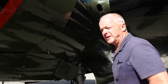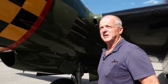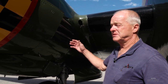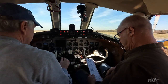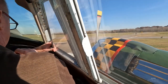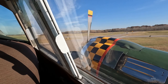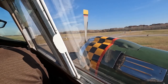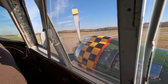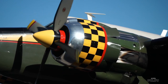It's a little different starting one of these. You're starting it with the mixture at cutoff, and you're actually starting it using the priming system, which unlike most engines, it doesn't prime in the cylinders. The carburetor on this is a big four-barrel Holley sitting on top, and you're actually priming — squirting gas in the carburetor inlet. It's a pressure carburetor. That goes right into the inlet of the supercharger and then onto all cylinders, so when you are priming it, you're priming all cylinders. Then when it's happy, you're holding the prime on and squirting that gas in there, then you bring the mixture up to a rich position, and it'll start gagging because it's got prime and the carburetor feeding it now, and then you let up on the prime and it catches on the carburetor. That's the way you start it.